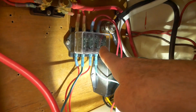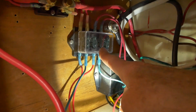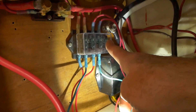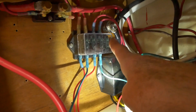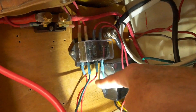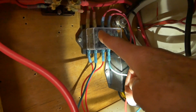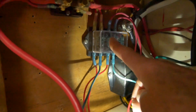The fuse block you see here has four one-amp fuses required by Blue Sea to protect the meters on the DC 8068 panel. The back two fuses go to the start battery and the house battery, and the leads from there go to the voltmeter on the panel. On the other side, the first two are the upstream and downstream voltage measurement from the shunt.